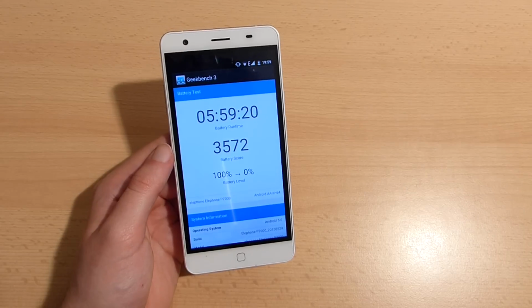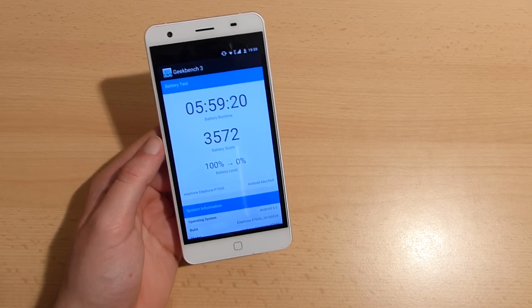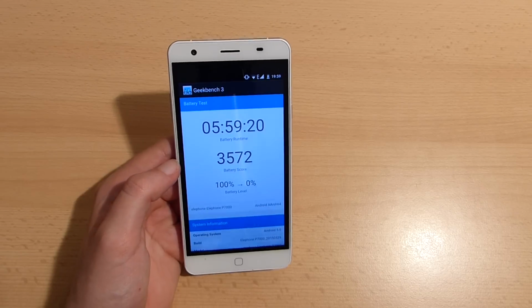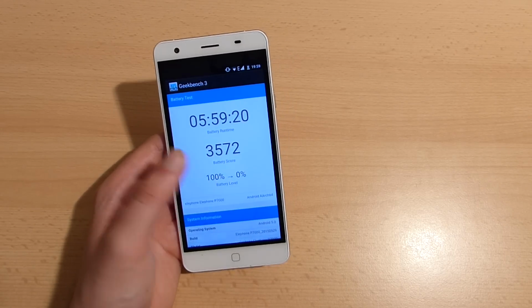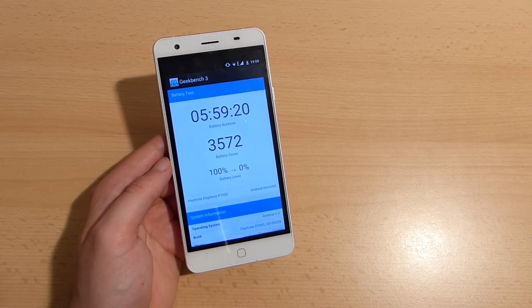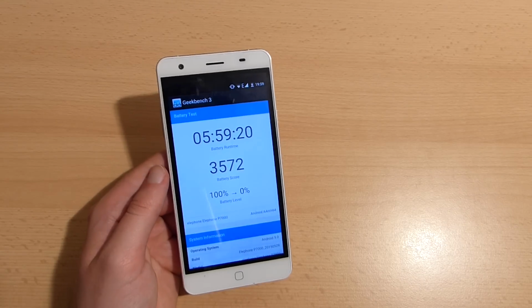Another downside that I noticed is the charging time of the battery. It takes around 4 to 5 hours to fully charge the phone, which definitely is too much if you're used to fast charging. And there also is some bug with the battery calibration, which causes the phone to suddenly shut down from 22 to around 15% of charge. So it's really strange. If you look at your phone, it shows 22%, suddenly it shuts off, you put it on the charger and it shows 0%. So they really need to fix that.